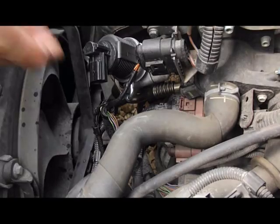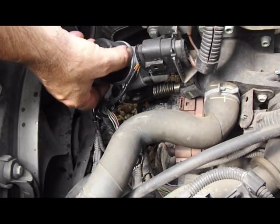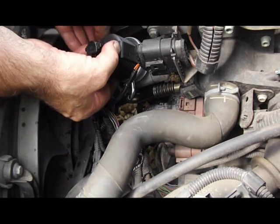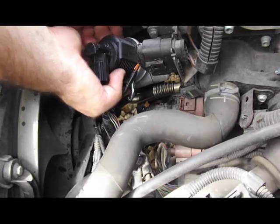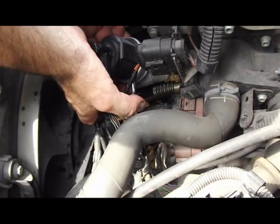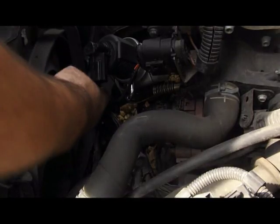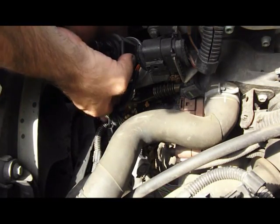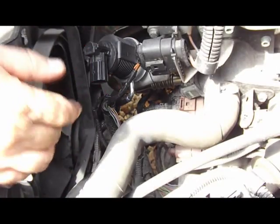Okay, I've got the EGR valve on now, got the metal gasket in place. EGR valve goes on there. Metal gasket on the other side, goes the other way around, facing downwards. A bit tight, these aftermarket ones. That's in place. Get the nut. What I've got to do now is get the bottom piece up. The tube underneath where the bolt's underneath. So there it is. And then just do it up.